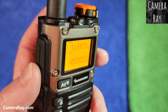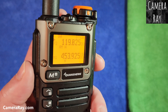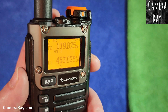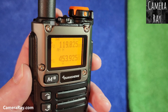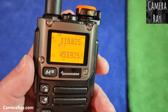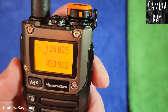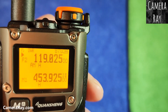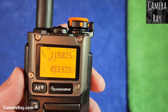Just hold these two buttons in while you turn it on and it'll give you the higher-end menu. Stock firmware cuts off at 60 in the menu, whereas this goes up to 69. Go to 68, change your battery settings, and that's really all you have to do to get a correct battery reading — which will show up at the top of the display. You can see it shows 87%, and that's all you've got to do when you upgrade your battery.